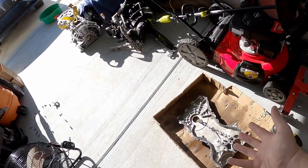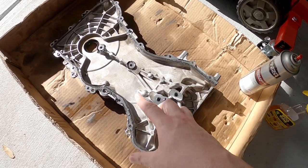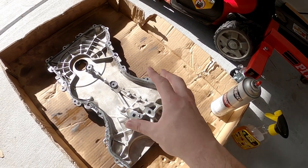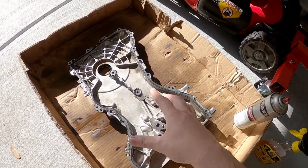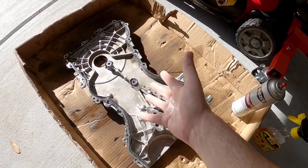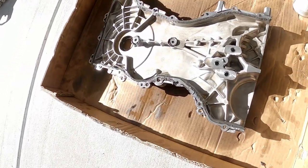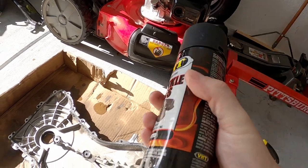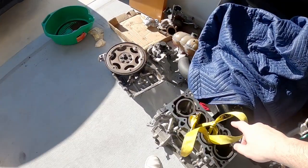This is actually the most important thing of this video. What about the timing cover? Well, not only do I have to get all this old silicone off — why did Ford choose to use so much silicone? I really hate the fact they didn't put a gasket here. To me, that's just the wrong way to cut costs, because when you have to take all these apart, you have to apply the silicone and you have to clean it up every time. I know generally this isn't a piece that is supposed to come off a lot — that rant aside, I have to get this cleaned up. Because I'm going to make it look pretty — I got some of this right here. This is going to make it look a lot nicer because it's just aluminum, it's gotten nasty over time, it's got oxidation on it and it just looks bad.